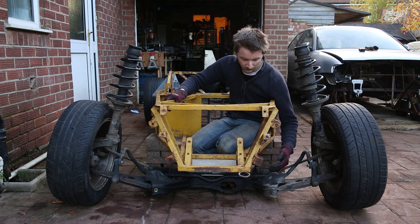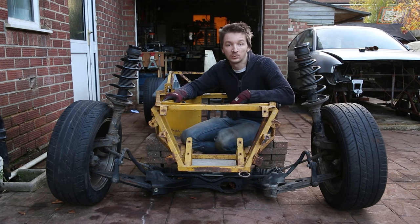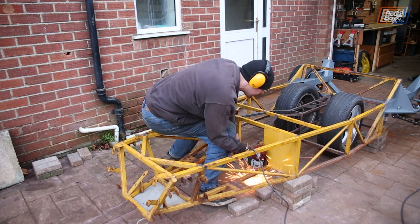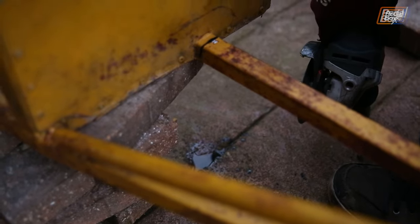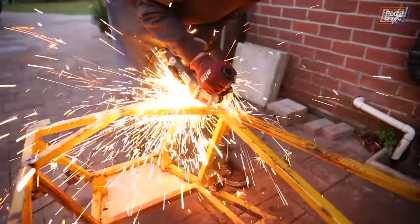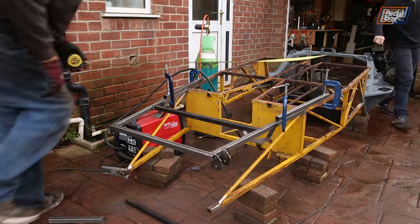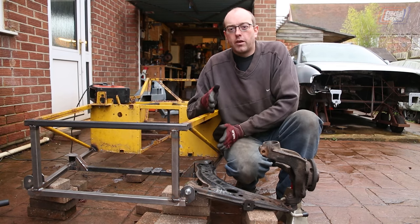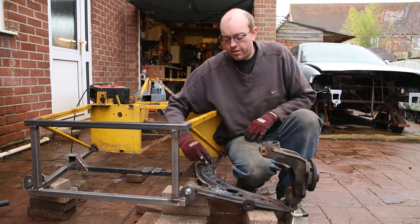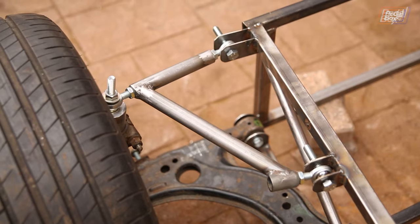The MacPhersons from the donor A3 and the TT clearly wouldn't work on this style of car, at least not without some fairly radical and probably controversial styling choices. So we got to work chopping off yet more of the chassis at the front. We set about hacking together a new frame for the bottom of the car that would take the standard A3 lower arm, allowing us to use the A3 hubs as well. In place of the shock absorber we fashioned a small round peg of the same diameter, which we could attach the top end of a custom upper arm to, creating more traditional independent front suspension.